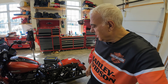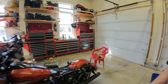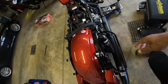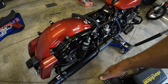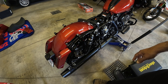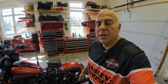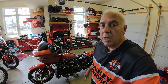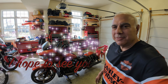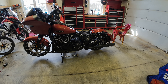So Marauders, that's it. I may give a short video on how the suspension performs on the road. The suspension is adjusted: this side is on setting four for 10 pounds of additional weight, and this side is adjusted for 14 millimeters — at least 250 to 260 pounds. So the preload is 14 millimeters; you can see the threads on it now. We'll ride it and see how she goes. Thank you for taking your time to watch this video. I'm not an expert on any motorcycle, especially a Harley-Davidson — this is my first one. I hope you consider subscribing, liking the video, and sharing it with a friend. Please take care and ride safe.